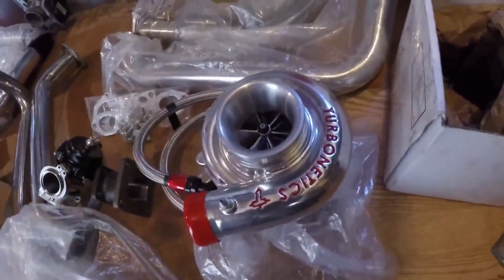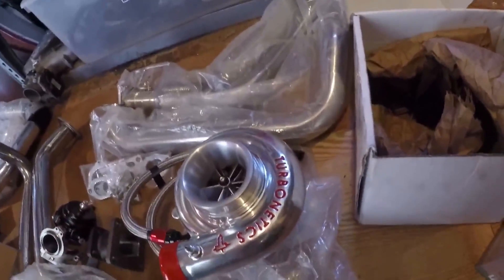The reason I went with a bigger turbo is because I don't want to be pushing it. I want boost to come on at around four or five thousand RPM because this is a daily driver — I don't want a ton of strain on the motor. The bigger turbo will bring the power band higher up, letting me drive normally and then when I want to get into it, downshift like I always do. I'm never racing below 4,000 RPM, so nothing's really going to change there.